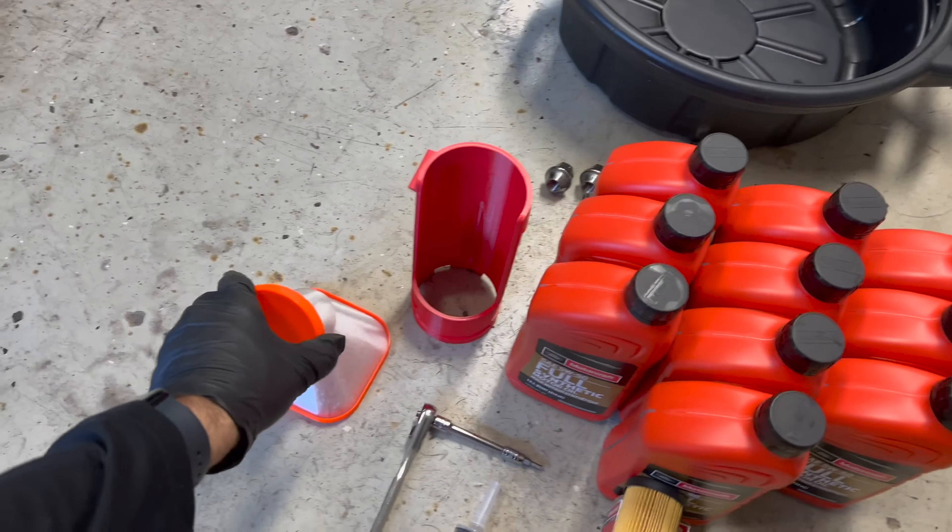Going in here, I'll show you where the oil filter housing is — it's right there. You can see that head right there; that's where the 27mm socket is going to go in from up top. There's also an aftermarket air deflector for brake cooling here, so disregard that if you don't have it — it would increase visibility a little bit if it wasn't there.